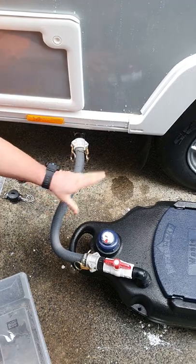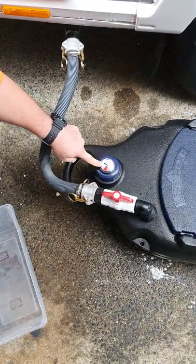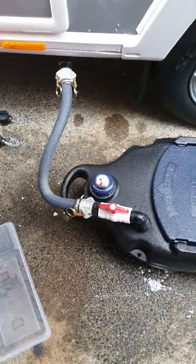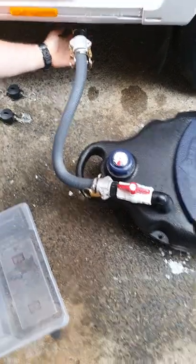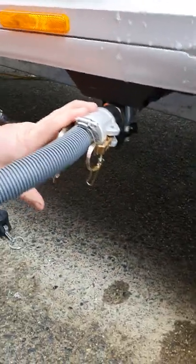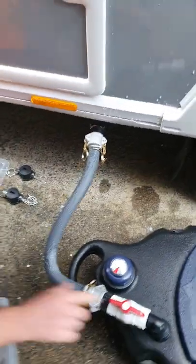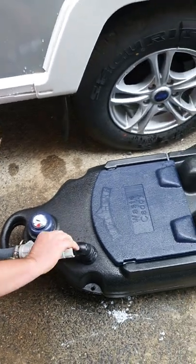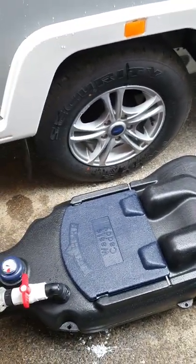So that's your greywater system set up. You do have a little full and empty gauge here, so you can see when it's time to empty it. When you're going to empty it, there is a valve in under here — if you've still got greywater in the line, you can shut this valve off and then you can come and take your caddy away. Just make sure this one's turned off, and that one down the end's turned off, just so you're not spilling it when you're moving.